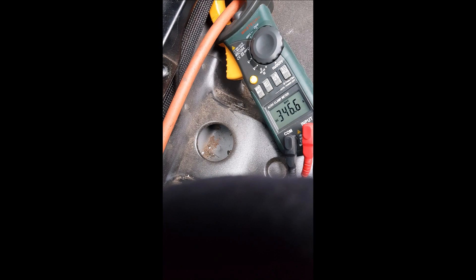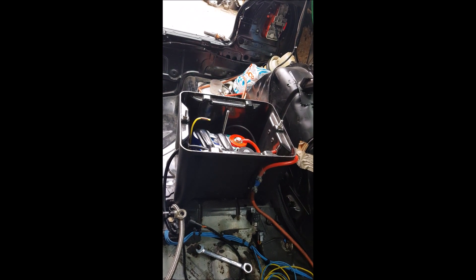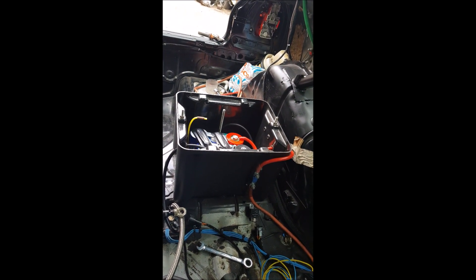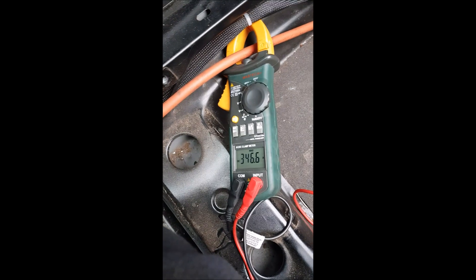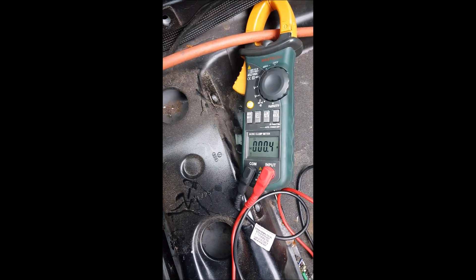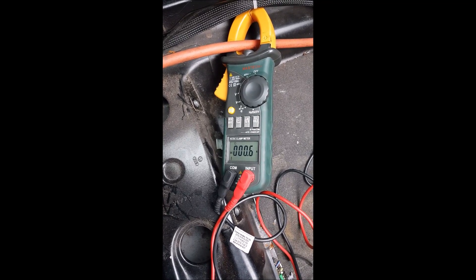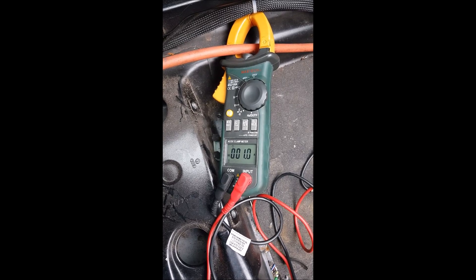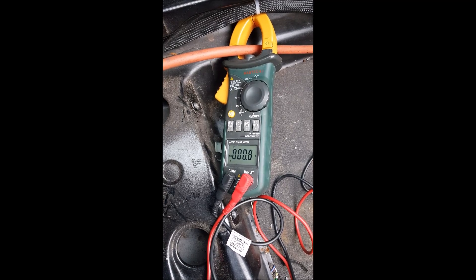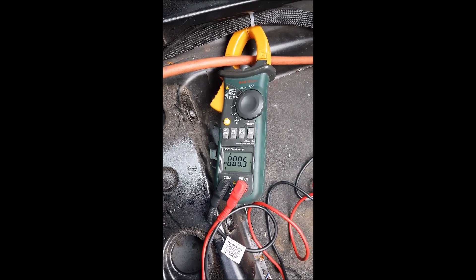The 350 amps cold crank — quite impressive. It's just on the battery to the engine to start. 346 amps from the capacitor bank in the boot, in the battery box — quite impressive. There's pretty much no current draw in or out of the cap now it's running. It's all coming off the alternator and the cap's completely charged at 13.7 volts. Very little current flow — pretty nice.